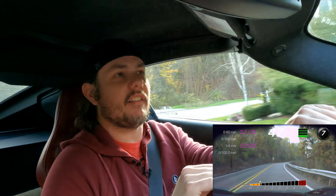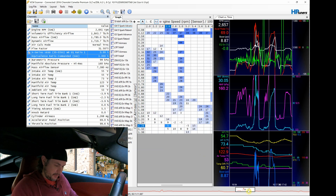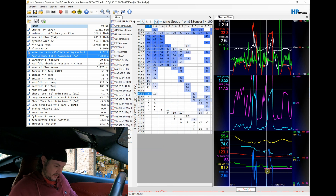We'll see what kind of benefits we saw from the water methanol injection, whether we're at a good area on our AFRs, and if we can go bigger for more cooling. Back at the house now with the data log pulled up, focusing on the two pulls where we got into a decent amount of boost. Pull number one is here, pull number two here — you can see on pull two that boost was a lot more consistent. Right about here is where water methanol injection should have turned on, and we're looking at temperature differential as the indication of whether we're getting cooling.